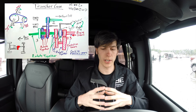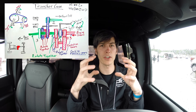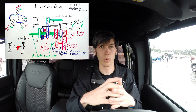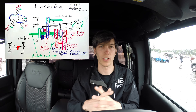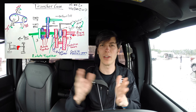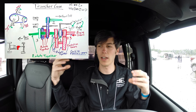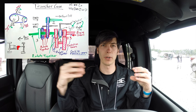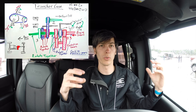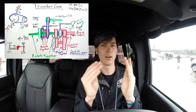To understand that, you need to understand the transfer case. You have the output from your transmission going into the transfer case, and then the output from the transfer case going to the wheels. Within that transfer case you have a set of gears — a higher gear and a lower gear — which you use for low range. With that higher gear ratio of the low gear, you're multiplying torque, spinning the engine more but getting a better torque advantage at the wheels. Putting it in neutral stops the input shaft from the engine, and stopping the vehicle stops the output shaft, so now both sides are stationary and you can switch between high and low gear safely — similar to a manual transmission where you need to match speeds.